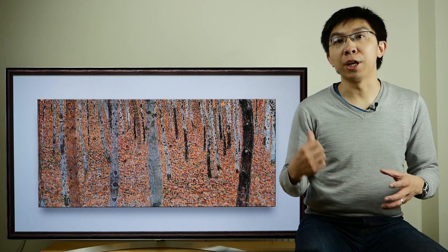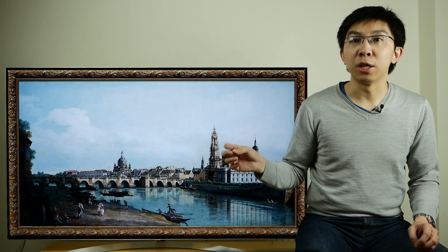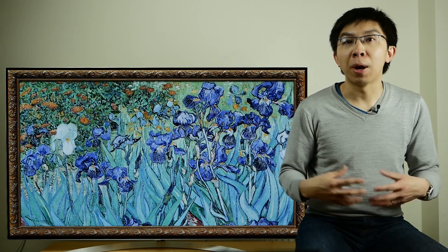Near-black uniformity is very slightly improved over 2016 models. On our B7 retail unit, there's no vignetting whatsoever when we put up 1% to 4% above-black fill patterns to check in a pitch black room. Last year's LG B6 tended to exhibit some minor vignetting especially on the right side of the screen. However, there's little improvement in terms of thin streaks of vertical banding just above black, although we rarely saw them in real-life viewing. There's also a blob surrounding text at the bottom left of the screen — that's a mechanism to blur high-contrast sharp edges on static logos and text to combat image retention. Don't be alarmed if you see it on your TV; it's been on LG OLED TVs for as long as we can remember, but is perhaps more noticeable on 2017 models because of increased brightness.